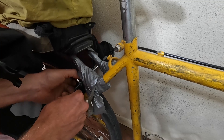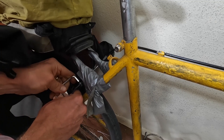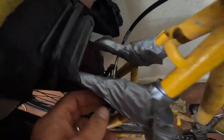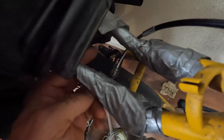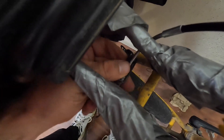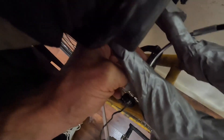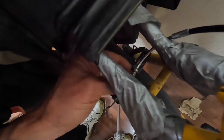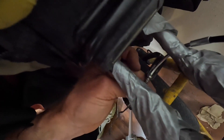Okay I think that's tight. As you can see, we still have the brakes engaged on both sides and the nipple is not through the bracket. The trick — you'll see this on GCN — is to slide this back through. Slide it through and if you get it engaged properly it won't come out. The nipple must be through the bracket for the brake to work, but when making adjustments you line it up to the edge, then when done slide it through.